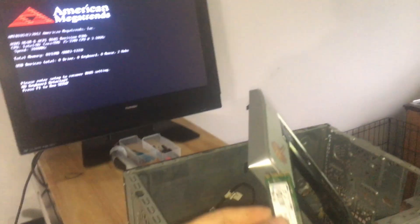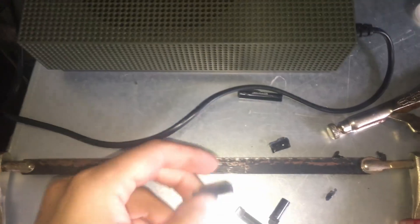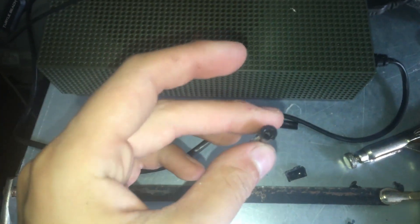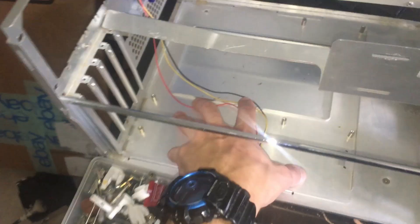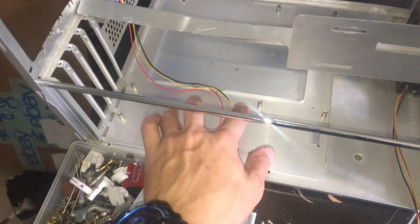Now we're going to switch everything out to the PlayStation 3. There's still an operating system on this M.2 SSD, but we're going to need an adapter. The PS3 housing bottom case — we're going to rip out the four or five screws and the little clips that hold the screws in place. I'm going to get that centered down so I can later fit this piece of metal housing that holds the motherboard and grounds it in place with the chassis.